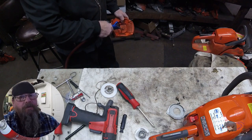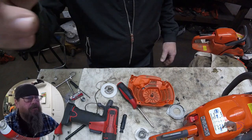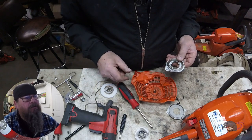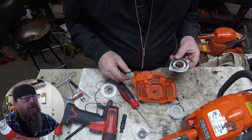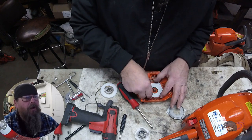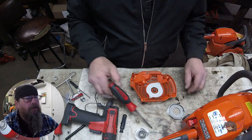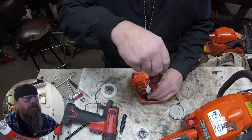One important thing you want to do is clean everything and inspect it for cracks. Inspect that center stud on the orange cover there for cracks. You see we got our new cassette — the spring comes packaged that way. There's a safety wire holding the spring in the cassette. Once you cut that safety wire, carefully set it in the orange cover.